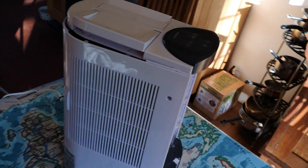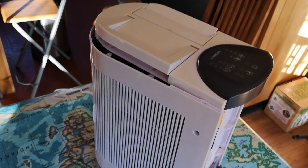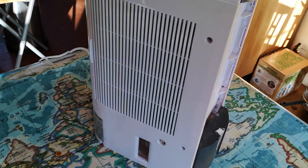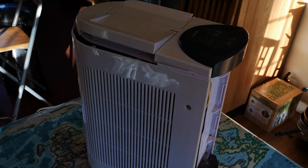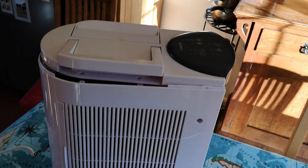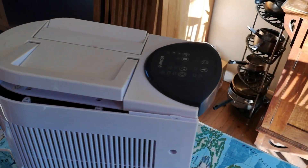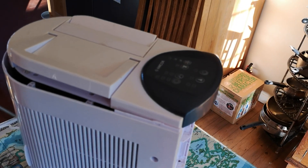I've got a damp problem in my garage - it's very cold and very damp. I do have a standard dehumidifier which works with a compressor like an air conditioner, with a coolant that blows air over a cold refrigerated matrix. But they do not work in cold conditions; in cold conditions they're more likely to freeze up.